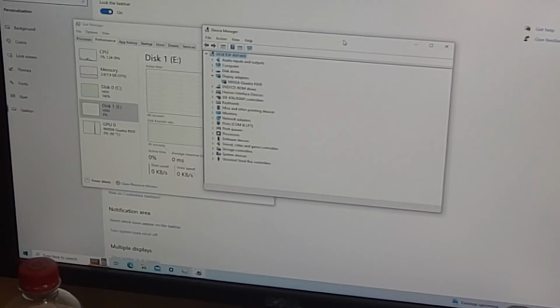Yeah, it's actually showing now. Did it just blink while I wasn't looking? So it's showing it has a K4000. I think the drivers for the K620 work with other video cards, because when I pulled this out of a different system and put the 1660 Ti in it, the drivers just kind of went on there. There's no internet connection, so it shouldn't have pulled in drivers. I'm guessing the drivers are kind of the same, even though they say Quadro on some and RTX on others. This doesn't have RTX features, but all these older Quadros say that.